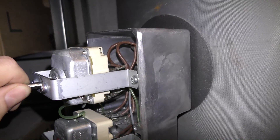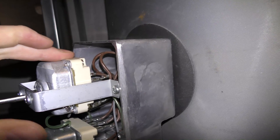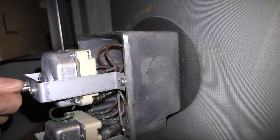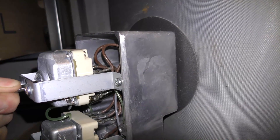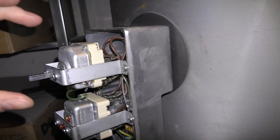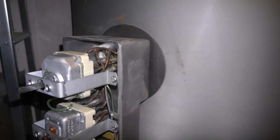We can listen to that — if I turn it down far enough, it will turn off. [click] There it is. And this is called a two-stage switch-off. If I turn it on slowly enough, you can hear that it actually switches on in two stages. [clicks] There are two switches. So what that does is: when the water is too cold, it will be using both heating elements, but when it closes to the right temperature, it will switch off one of them so that the temperature rises slower.